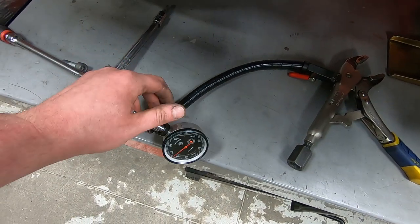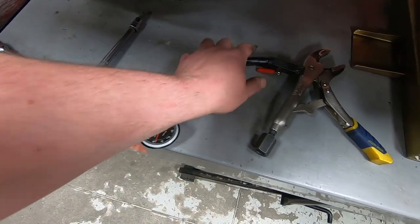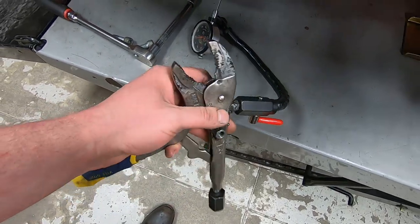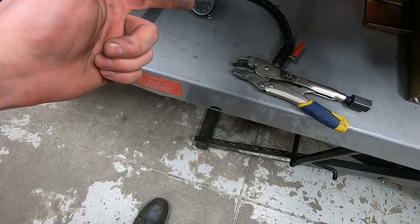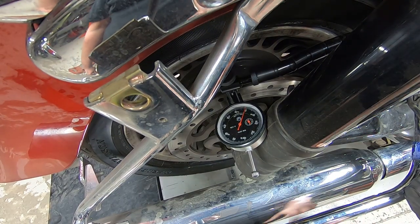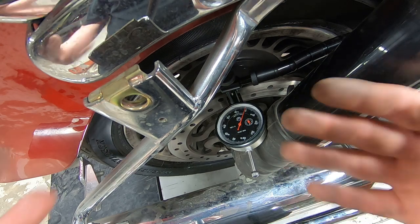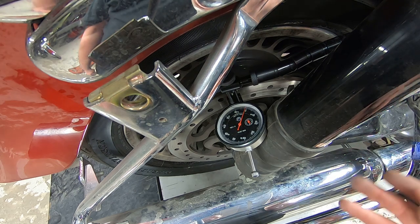This is the little indicator setup that I have. It isn't very expensive, it's super cheap. I probably just bought this thing off Amazon. And then I wanted to use it on a vice grip setup, so I just welded a nut onto the end of my vice grips, or the top of it, so that you can just vice grip it to something. I'll put a link down in the description if I can find one on Amazon, but check it out if you need one. So I already have the wheel off the ground using a flat jack, and then I like to put the vice grips on something where it's not a visual finish. So it's on the back of a nut for the saddlebag support bracket.